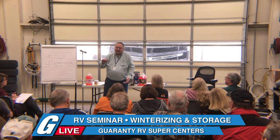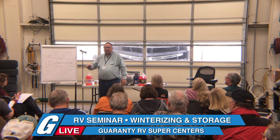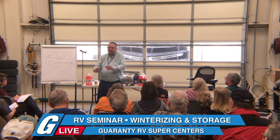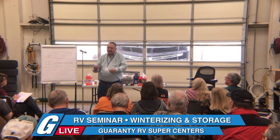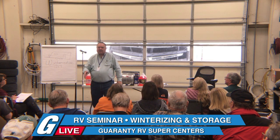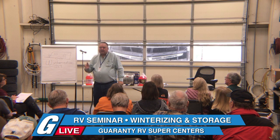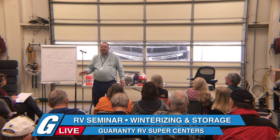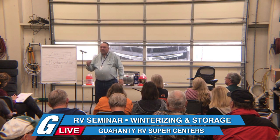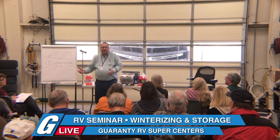So they ended up, they wanted to sue us, so I said, "I tell you what, we're going to buy a refrigeration type Sears Kenmore dehumidifier. Costs us less than $300. We're going to sit in there for a week. If the problem doesn't go away, we'll bring it in and we'll fix it." Problem went away. So if you're living in it, you've got to have a way of getting rid of that moisture from living.